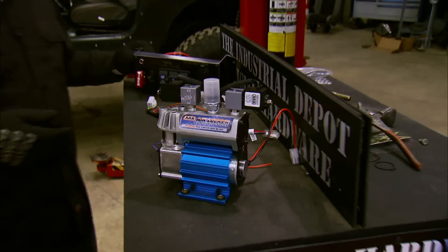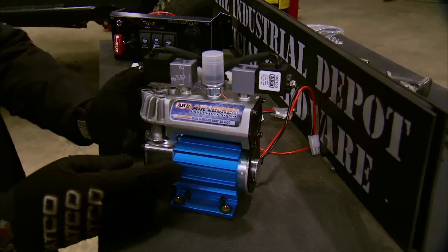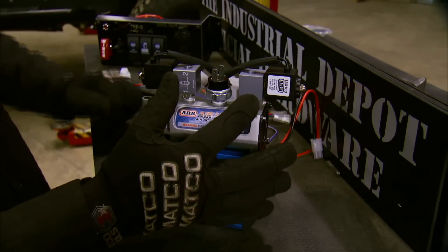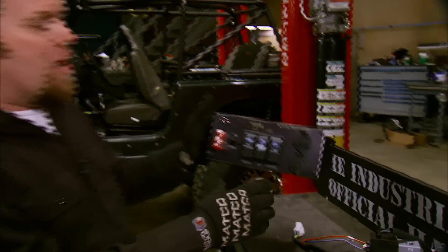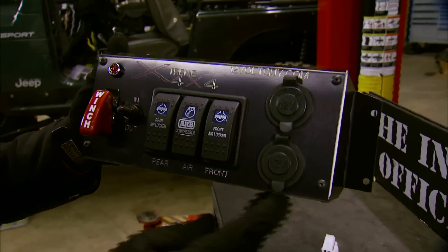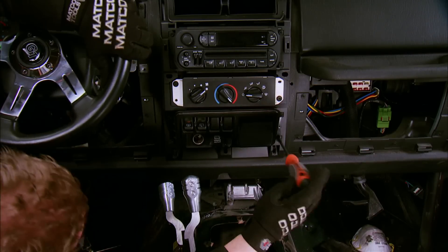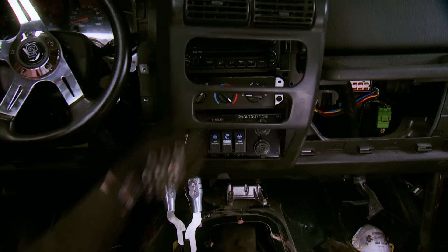Now it's a perfect time to show how we're going to control the air lockers front and rear. The ARB air locker activation system is not only a small air compressor — it also has an integrated air tank that holds just enough air to control both lockers. It comes with a pre-terminated wiring harness set up so you have to engage the rear locker before you can engage the front, which helps protect parts inside the front axle. Instead of just mounting the switches in the dash, we called up Darren the 12-volt guy and had him build a custom switch panel with integrated winch control and all the locker controls. The panel mounts right in the dash behind the factory trim and gives us two 12-volt power sources for things like cell phone chargers. The ARB air compressor will mount right underneath the seat.